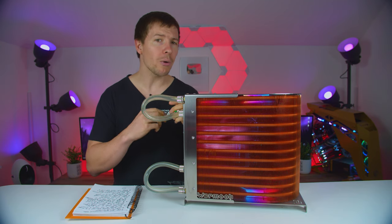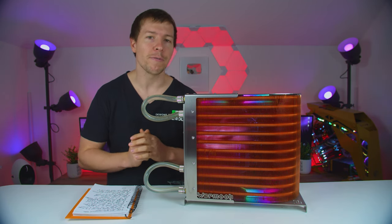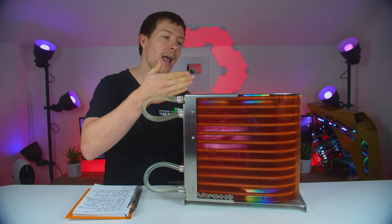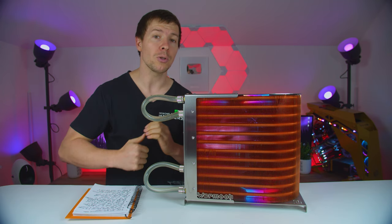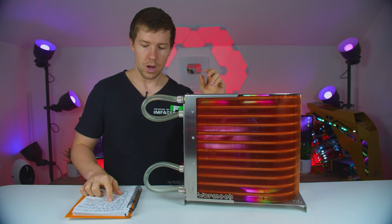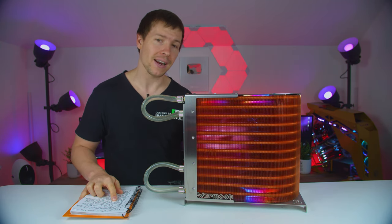The ports looked like they were going to go past the motherboard tray, but the thickness of the fittings could not fit, and you can't actually fit a 90 degree fitting between the motherboard tray and the GPU block. So we had to put those offset fittings in. So one more level up would have been perfect. A radiator hinge door would have been perfect for ease of access.